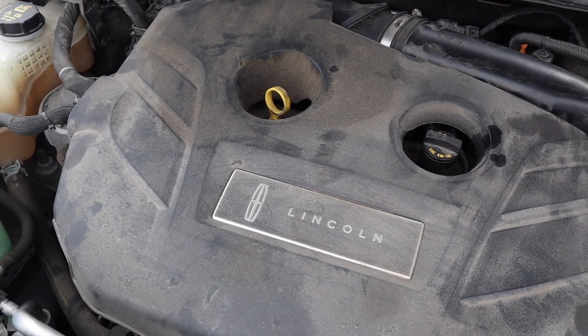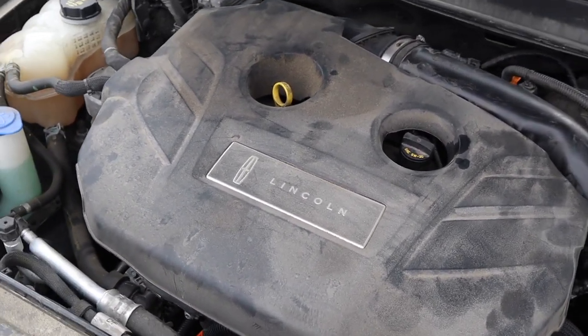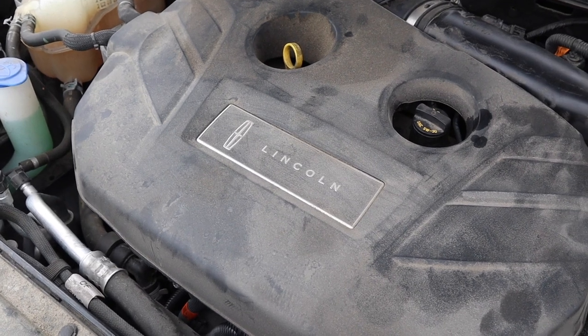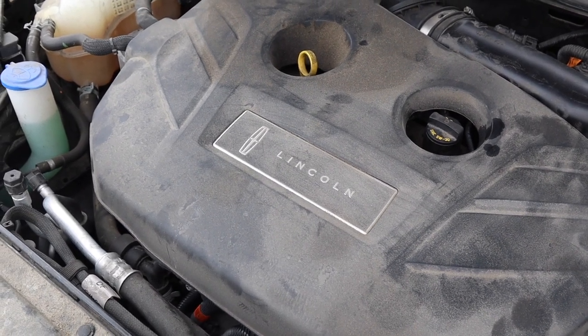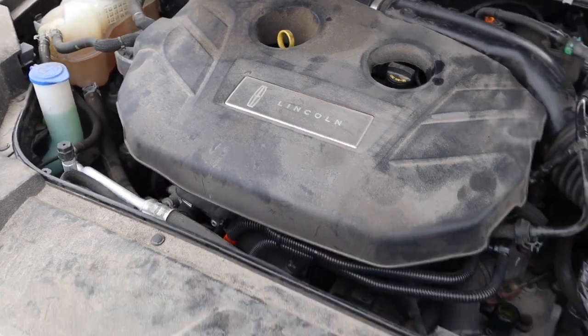Okay, so I'm not gonna add any more. We're probably somewhere between 5.4 to 5.7 liters on this car, and that's what I would recommend you guys do. But check the dipstick, level ground. I've repeated it a million times. Let's get on with the whole washer fluid thing now.